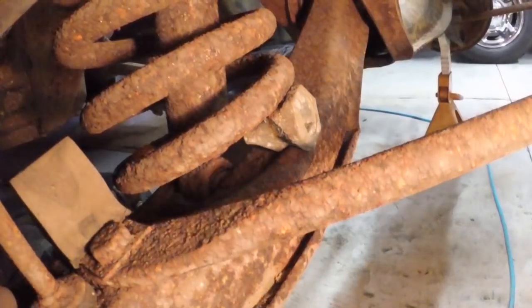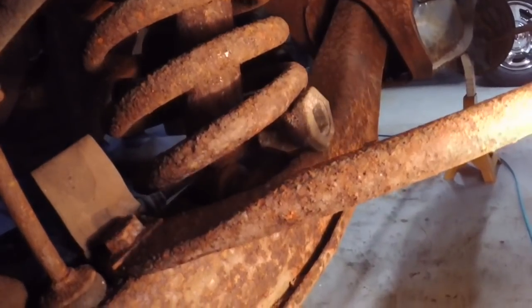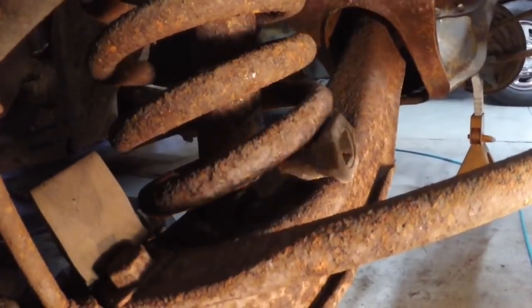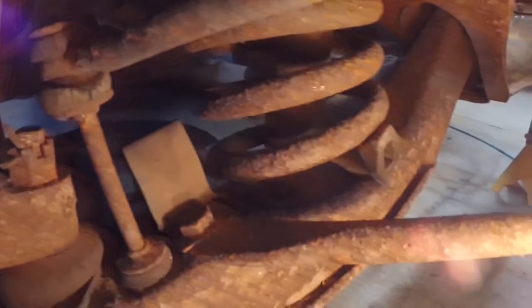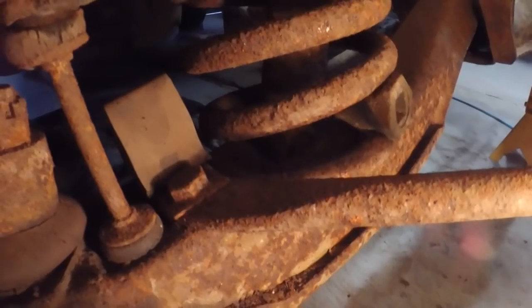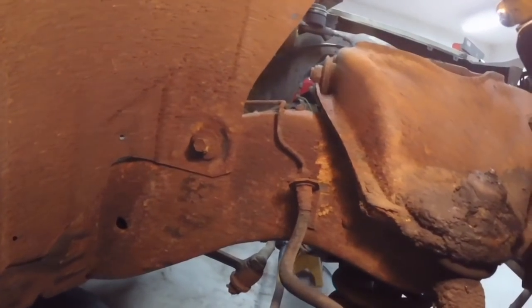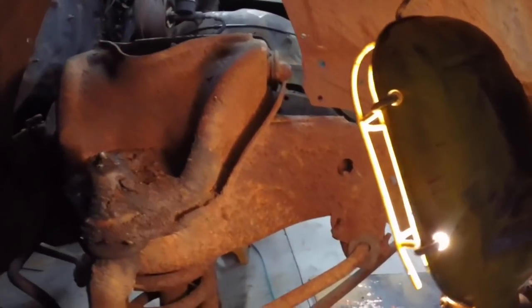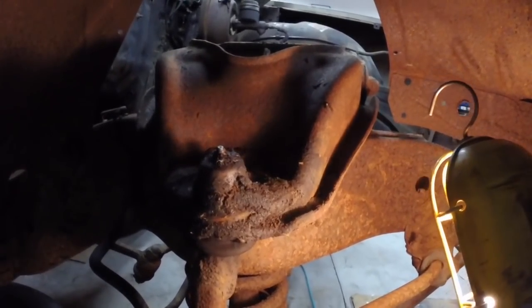Now you get a bigger picture of why this car needs springs when you see those jammed in. It probably is the original factory shocks in there too, from the looks of it. I don't think this car has really had much done to it. These need to be replaced. This is all going to be a part — I'll check the ball joints, and if they're bad it'll get new ball joints, if they're good they'll stay. The control arm bushings on this side aren't bad, but if I'm doing the other side I might as well do these too — it's not a ton of extra work when you've got the engine out and this far apart.